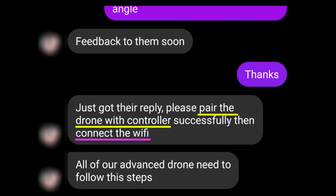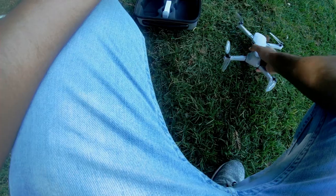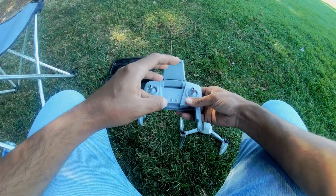Back in the park again. When I was here last time I had a very rough time getting this drone up in the air. The problem was I connected it on the app first and then it doesn't connect on the remote controller. I talked with representatives from Holystone and they told me there is a particular sequence you have to follow to connect to the drone and get both video footage and control from the remote controller. Let's go ahead and try the correct sequence.